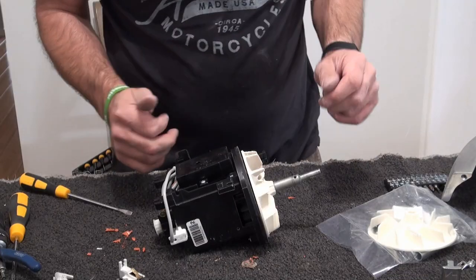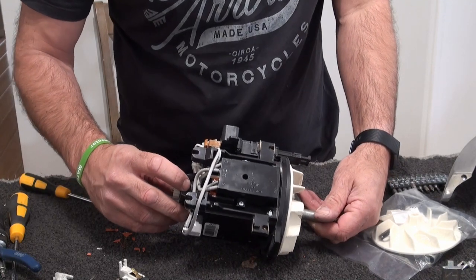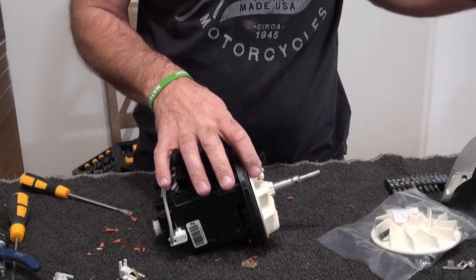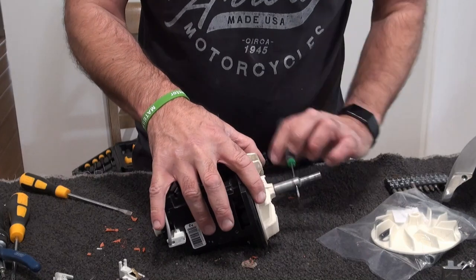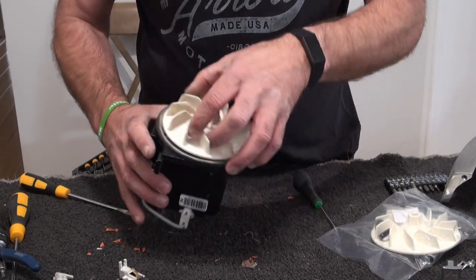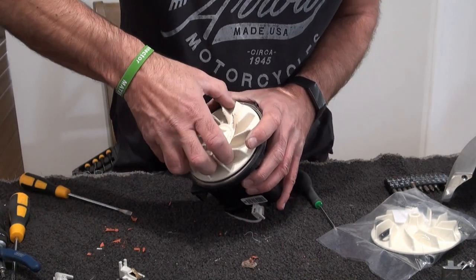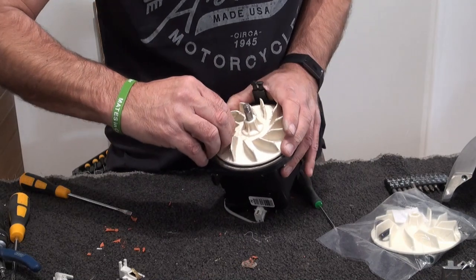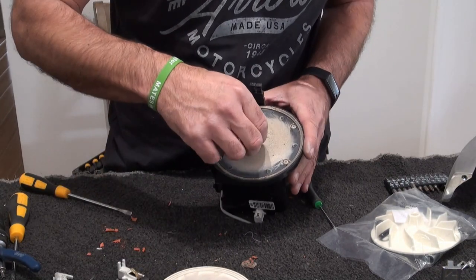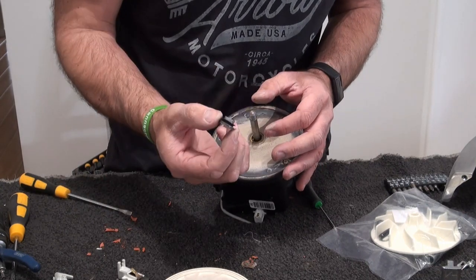So anyway, to take this fan assembly off, there's like an 8mm bolt head there. You need a quarter thin spanner to fit in there, but nine times out of 10 it's just literally a case of holding that and just cracking this anti-clockwise, and there you go, off it comes. So they're normally pretty loose. Then you should have a little washer, and this should be quite brittle to pull off. So you can see it's quite nasty behind there. There should be another washer there, and then a rubber seal which is there.